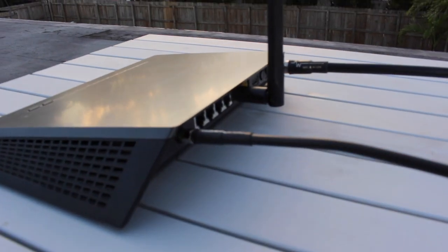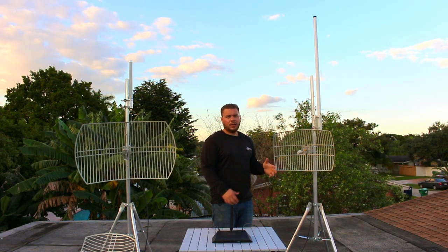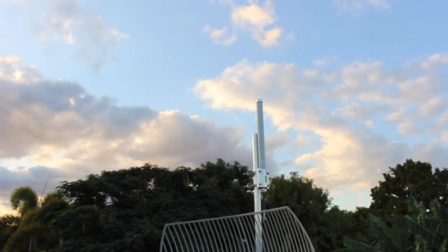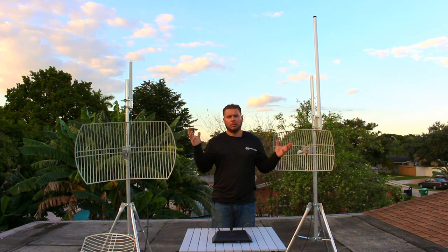In this scenario I decided to go full omni. We still have the internal antenna inside the house to give some signal indoors, but we're using the same cables plugged into omni-directionals. Over here I have a 15dBi omni-directional antenna with a radius of about a mile and a half max, covering 360 degrees. On my right I have a 12dBi 5GHz antenna — so I'm still dual band. This router is transmitting both frequencies at a high level outside, which is great for campgrounds or landlords of apartment buildings who want to share dual-band signal to multiple people.